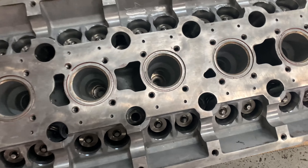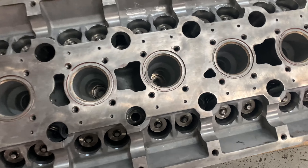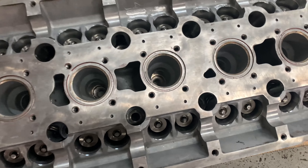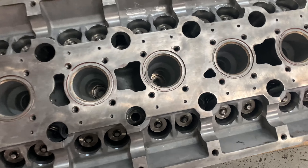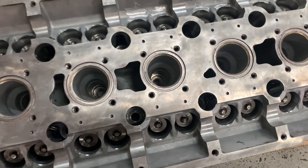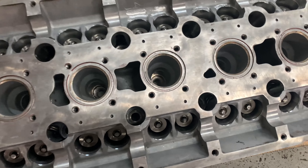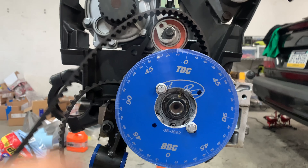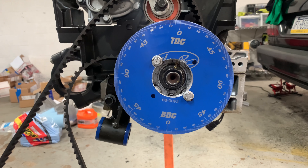Another degree wheel for the white block engines — I ordered a standard 6.5 inch degree wheel and whipped up a quick drawing in CAD. It's basically 71 millimeters between bolt holes for the crank pulley sprocket. I'm going to center that, mark my holes, then drill out the center with a hole saw so I can still spin the nut. Pretty easy process. This should make cam timing a lot more accurate — figured I'd show this to guys who have aftermarket cams and have to time them using true top dead center.